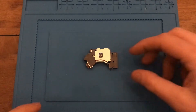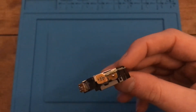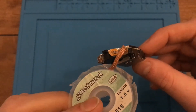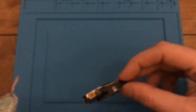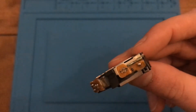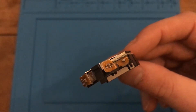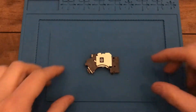For the new lens, I just want to highlight that they all come with an anti-static solder blob. What I'm going to do is take my flux pen and apply some flux there, then use some desolder braid and carefully get all that off. I'll do that off camera because the angle makes it really difficult – I need three hands – and the ribbon cable it's attached to is very delicate, so I don't want to risk burning it.